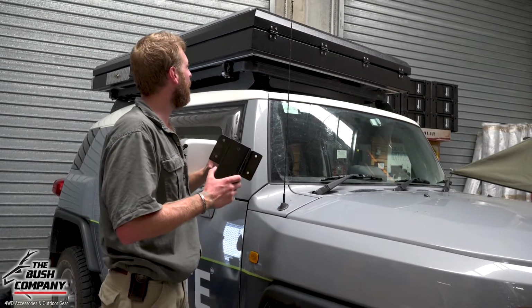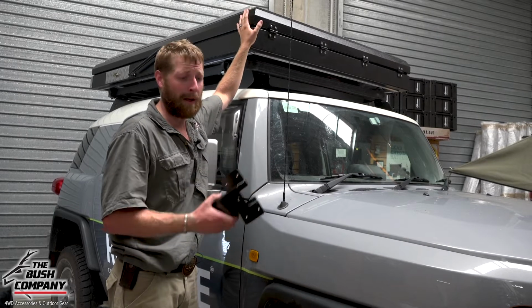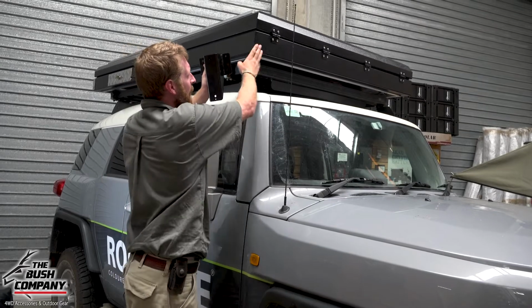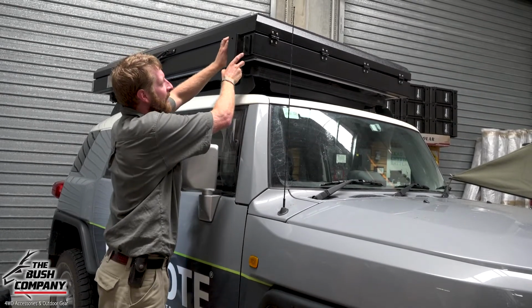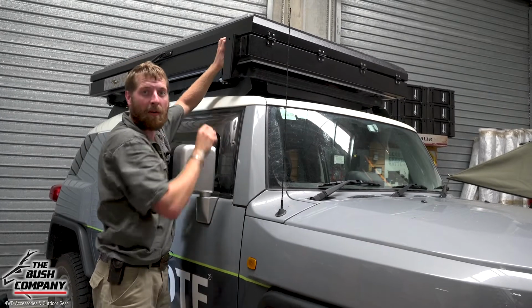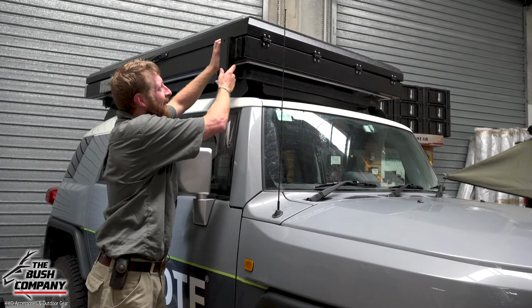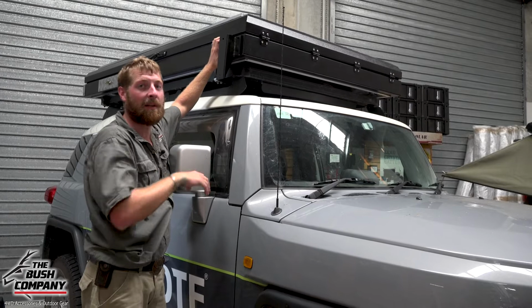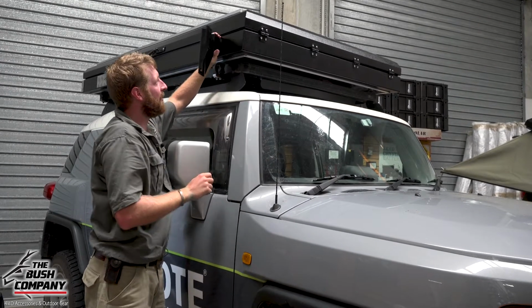But what I want to focus on is that, yes, our tent can handle the weight for the awning. Now, it's not going to be a straight-in fit, in other words, using our existing bolts to the tent itself. So we're probably going to, once that's mounted up, we're going to have to drill a new set of holes to match a specific awning. And really, these brackets can be used for any awning, whether it's a straight pull-out awning or another brand of 270-degree style awning. It doesn't really make a difference. So the universal brackets are great for that.